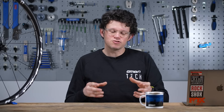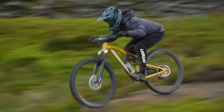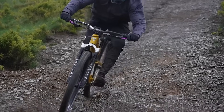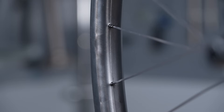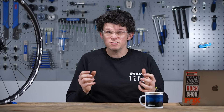An isotropic structure means the material's properties are the same in all directions. Anisotropic means you can tailor those properties to be different in different directions — which is pretty much perfect for a rim, because it's going to have different loading requirements in different directions. With carbon, we can tailor this optimisation to the ultimate degree. The carbon laid up by hand, like it is in these Reynolds wheels, offers near additive manufacturing levels of optimisation. Individual sections or plies of carbon are laid up in different orientations and orders, and the precision of where those layers are means the carbon can do its engineering wizardry.